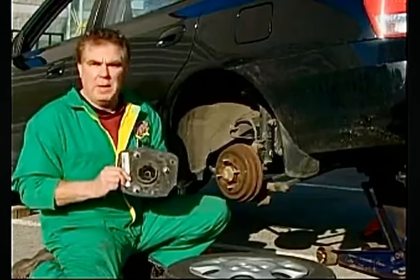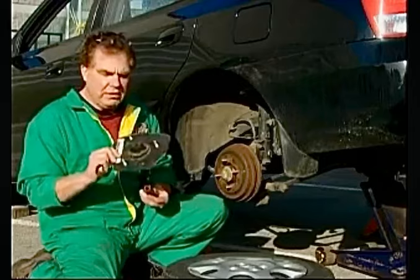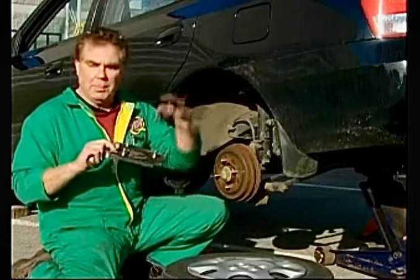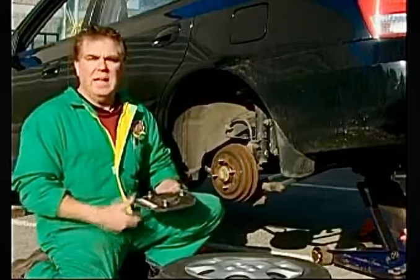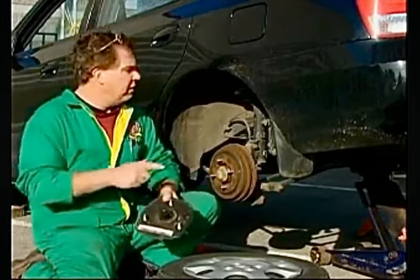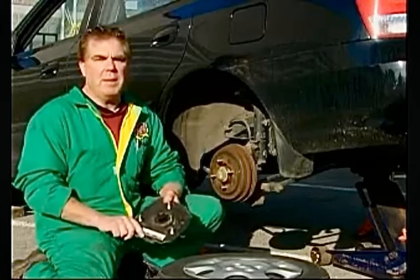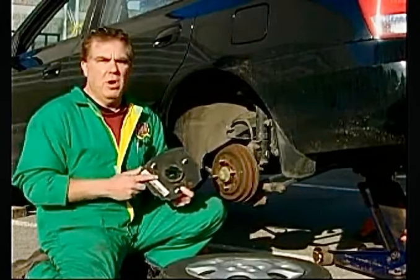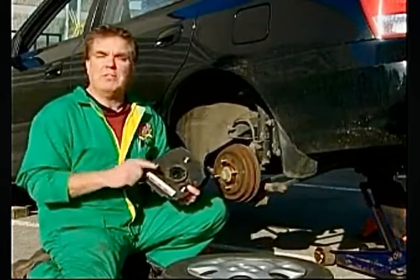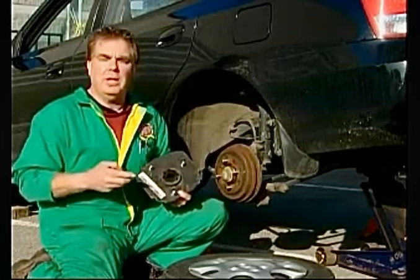So when I took the suspension apart in the Impala, one side had done this. One side was perfect. The other side had this worn out mount. Compressed the spring, replaced this mount, put it back in, noise fixed. And you know what? It often is a process of elimination going through that rear suspension to determine where that noise is coming from. And it often comes down to looking at everything, determining there's no other problems, and then going into the struts.